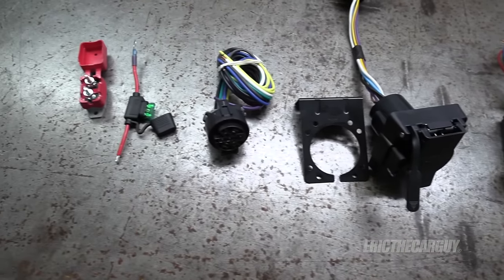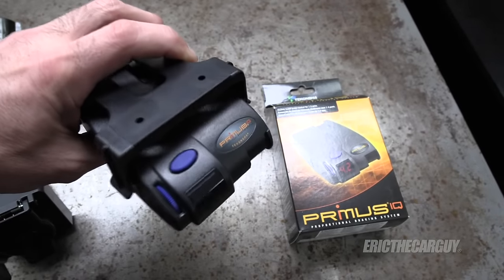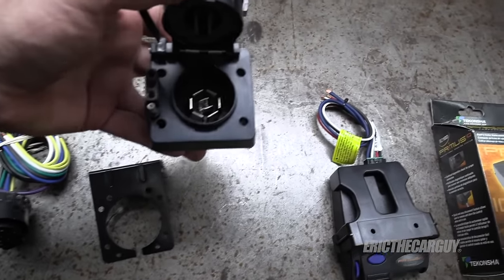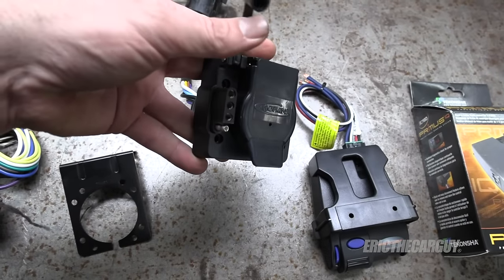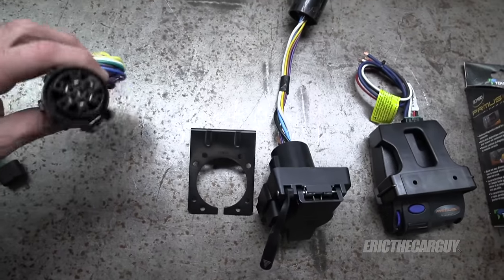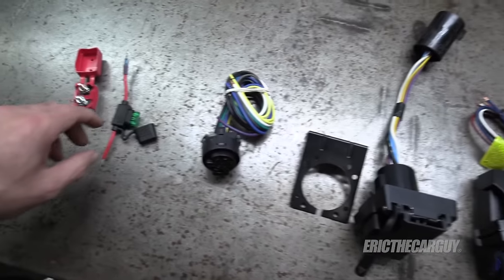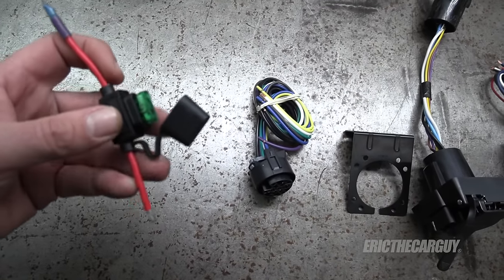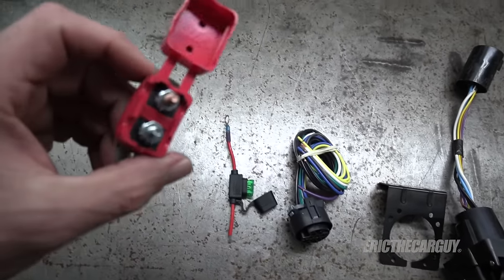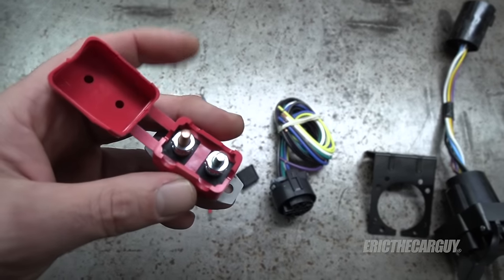Here are all the components I will be installing on the truck. We'll start with the trailer brake controller — I'm linking all these down in the description. I also got this seven-way plug assembly, which also has the four-way style as well, so it's capable of doing both. There's also a repair harness for the seven-way that plugs in and provides all my connections to the vehicle. I have a 30 amp inline fuse assembly and a 30 amp resetting circuit breaker — this automatically resets after a trip, which is super important for this installation.